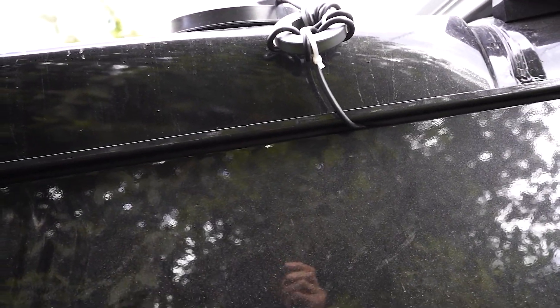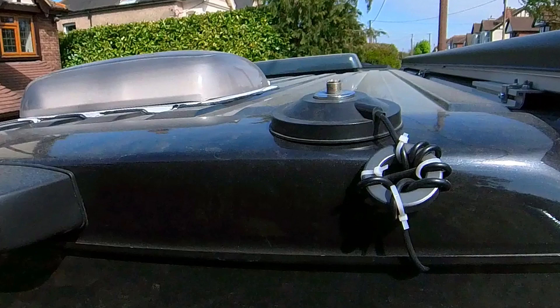Unfortunately, there was a problem with the mobile antenna, because in previous vans I've used, I've been able to mount the antenna on the rear door of the van and it's worked quite well. There's a lot of metal there and it's pretty well coupled to the rest of the body. But on this particular van, the door is recessed such that you can't get a mobile mount on the door and close it. So I had to go for the second option, which is a magnetic mount.